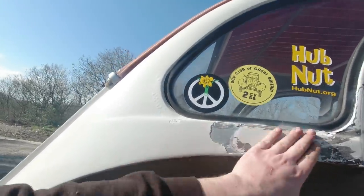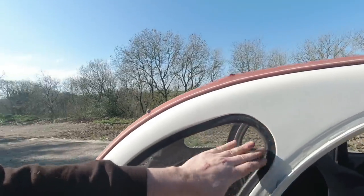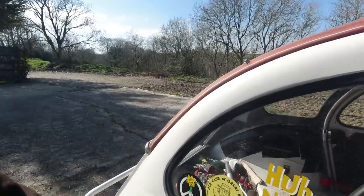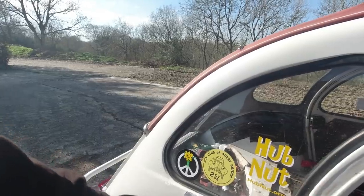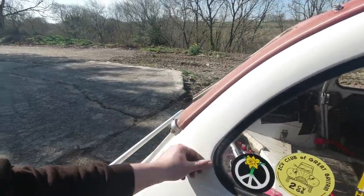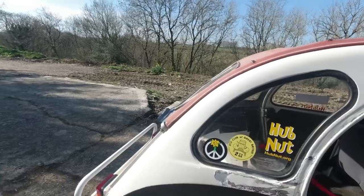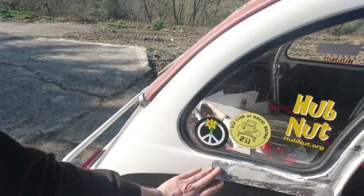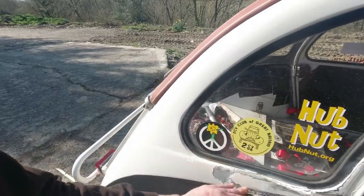This is the area of paint I'm looking to tackle today. I'm not going to take this window out because they are quite horrific to get in - there are a number of really tight angles. I've already got loads of paint all over the rubber anyway. I will try and mask it off - my plan is to just use a heavy build primer, might go over it with some zinc primer first, then go over it with a heavy build primer so I can get it back to the right level. There's a weird thing going on with the paint - I've got bubbles in here as well. But where do you stop? If I just keep digging I'm going to end up stripping this entire rear quarter. Thankfully the Zintec coating seems to do a really good job of protecting the metal, but we've got to do something because the paint is flaking off.